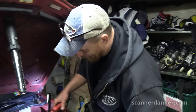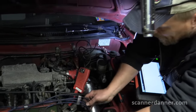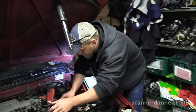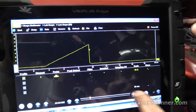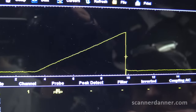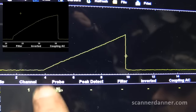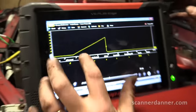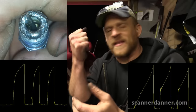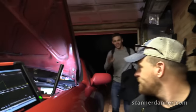I almost forgot — you want to see the coil primary current ramp pattern. We'll do this running, so it'll look a little different. We'll have noise from these plug wires now that we have spark. Notice the turn-on — 20 milliseconds, that's good — and totally different looking now. You don't see a turn-on oscillation, but you also don't have that little straight-up line at the beginning that indicated a shorted secondary winding — or rather, a shorted secondary, which can also be a crushed spark plug with a closed gap on a single-coil system.